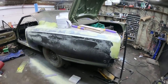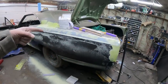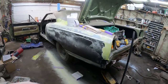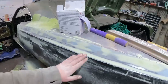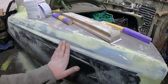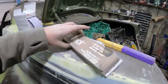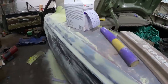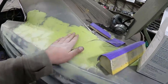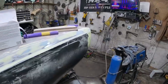I took a little advice from my buddy Bad Chad — you just flood it with filler. Actually I don't know Bad Chad at all, he seems like a pretty good guy, he's Canadian so he's got to be good. Go tell him what's up in the comments for me. The first coat came out pretty straight. I just use my longboard — I have this little one here and a little teardrop job to get in there. I'll get in here with the flat board and then just down the side and the back. No big deal.